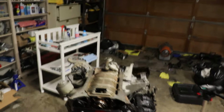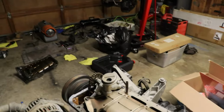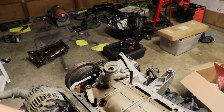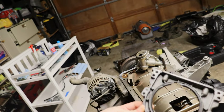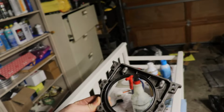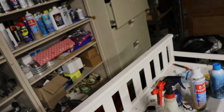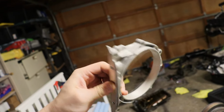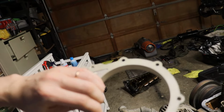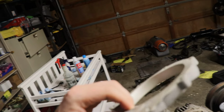All right guys, what's going on? Checking in. It's been a while for me, not a long time for you guys, but it's been probably over a week or so since we last filmed with the M111K here and our oil pump and pan swap. And I picked up a few pieces because after basically seeing that our old rear crank cover or rear main seal cover was not a replaceable gasket style cover, I ordered the updated part number, which is like this, which we'll be able to fit our seal into. It's a little bit different. It does not have a groove for the seal to fit into, but I don't think that'll be a problem.